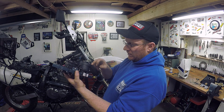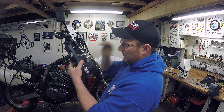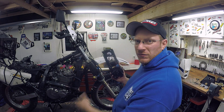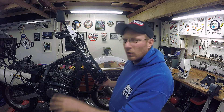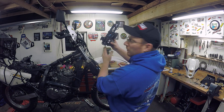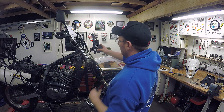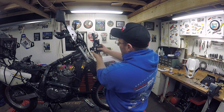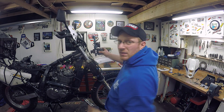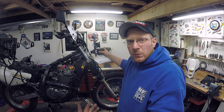The Hella light with the Cyclops low beam is adjustable and the Squadron up top is adjustable, so I'm happy keeping the fairing level with the bike on the stand for the rest of the project — it makes things so much easier. The bottom of the fairing needs to be four-and-a-half to five inches away on a somewhat horizontal plane. The first step is going to be figuring out how to connect these frame mounts up to the fairing mounting points.